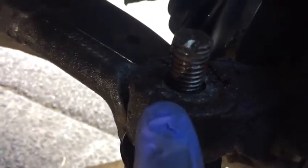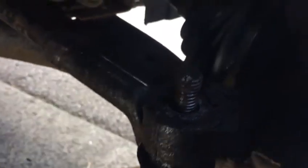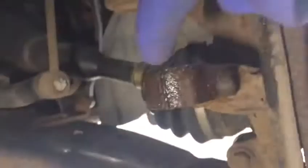What we do — we're gonna hammer this area and on the top to drop this track rod down. That's it, we dropped it. As you see, this is like a cone — it's a ball joint, and inside is the same thing. So we're hitting on the side of this one to loosen it and drop it.